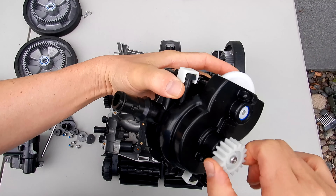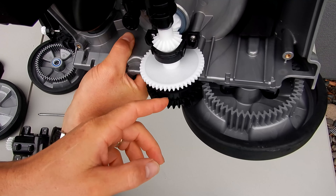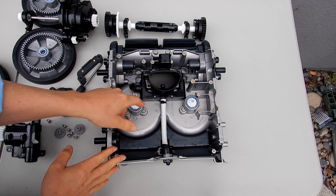There are just two more parts inside the cleaner: the drive shaft and the water management system. I'm going to remove the drive shaft — you may notice that the teeth here are worn down, which will cause the cleaner not to move properly. You can see how the teeth in the drive shaft grab the teeth here on this wheel; if any of these teeth are worn down, either the drive shaft or the wheel, it's not going to move properly. The drive shaft is held on by eight screws — two here, two here, two over here, and two more here. Once all the screws are loosened, pull the drive shaft straight up. You also may notice this part here worn down on the drive shaft — it's attached to the cyclonic turbines, which may not be spinning if this part is worn. I suggest replacing the whole drive shaft assembly at that point.